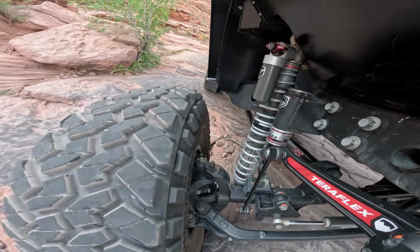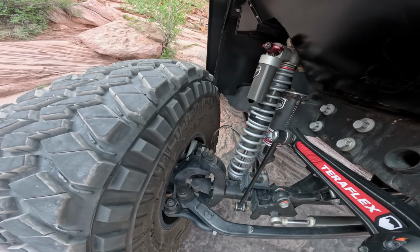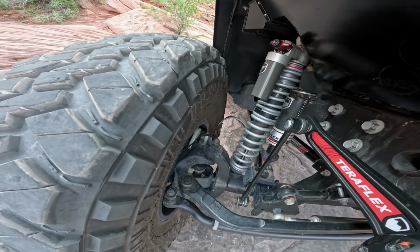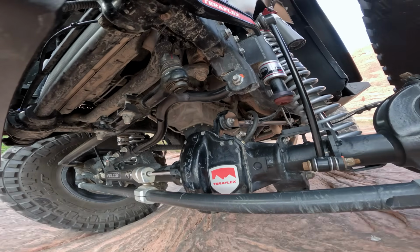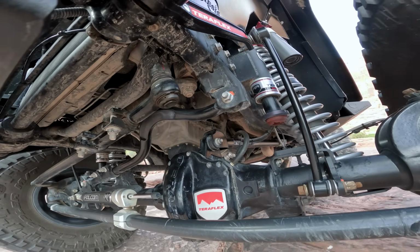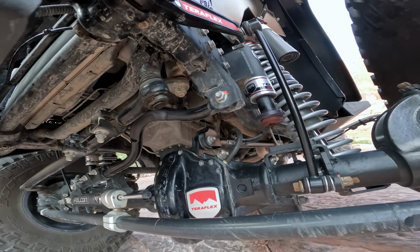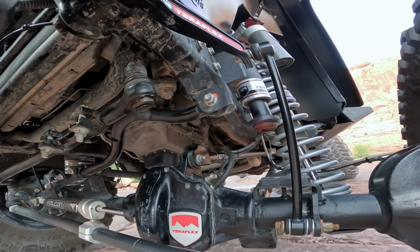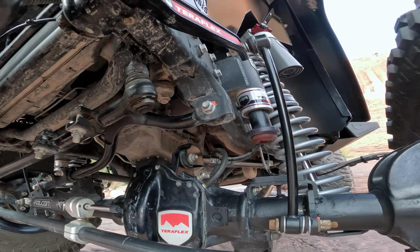The arm itself ties onto the sway bar, which is a torsion bar, 4140. It's like a mean little bar there, so it gets a lot of resistance to give you some stability on the highway. It goes down to our sway bar links. It's actually a joint at the top and a bushing at the bottom, so it's quiet. You're not going to listen to the things.